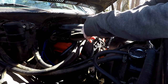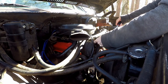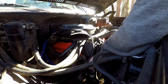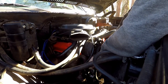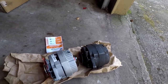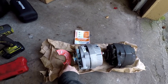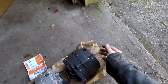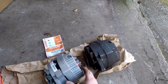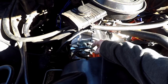Let's pull the alternator off. First off, I want to loosen it — just going to loosen the two mounting bolts. Actually, I can take this one out all the way. This is a long through bolt. New versus old — the photo had the pulley actually being black, I thought that would have looked really good, but this is okay. It looks a whole lot better. Everything matches up terminal-wise, it even comes with new nuts, and our plug connection is the same. Should be good to just throw this in there. New alternator is in, wires are plugged in, it's all tight, tensioned appropriately.